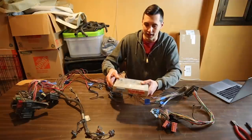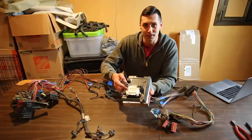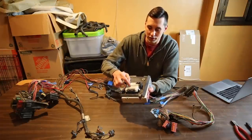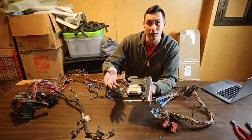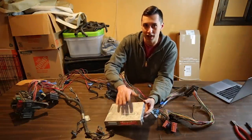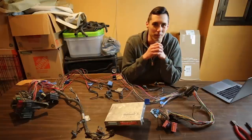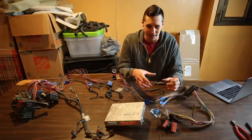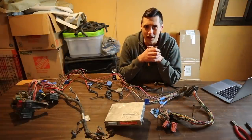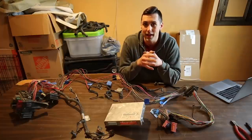The GM PCM is coming out of the vehicle and won't be used. On the other side is the VSSB — the vehicle speed sensor buffer — and this is actually going to be staying in the vehicle. It takes an alternating current speed signal from the transmission and converts it to the signal used by the speedometer in the instrument cluster. Now, while the GM only has a single PCM that controls the engine and transmission, the Dodge has an ECM and a PCM. The ECM, made by Cummins, specifically controls the engine, while the PCM, made by Dodge, controls things like cruise control and interfaces with various gauges. In this Cummins swap I'm going to be using both the ECM and the PCM from the Dodge.